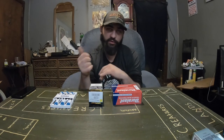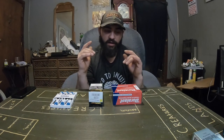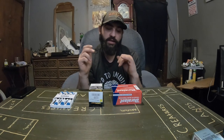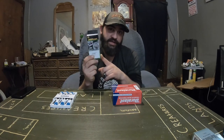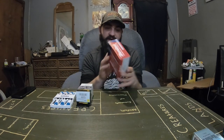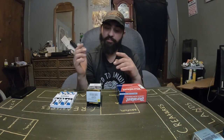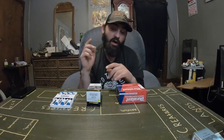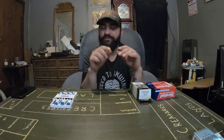Still won't start, won't fire off of starting fluid - nothing. It'll crank and crank and crank. I described a couple of things it was doing to a mechanic buddy of mine, shout out to Joe, and he said try the ignition. So we have a lock cylinder because I know I needed one anyway - I'll show you why when we get out there - and I have the actual ignition module.